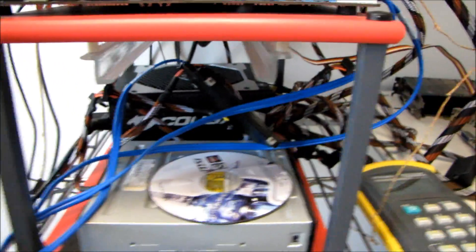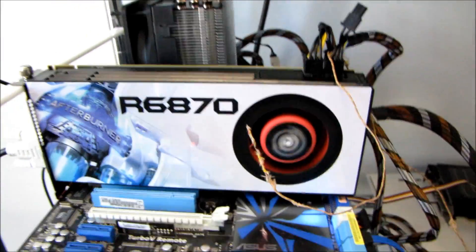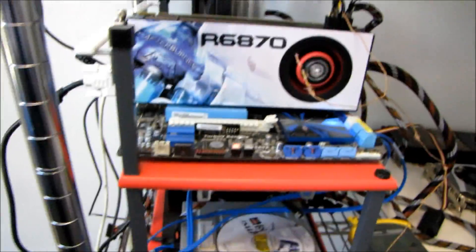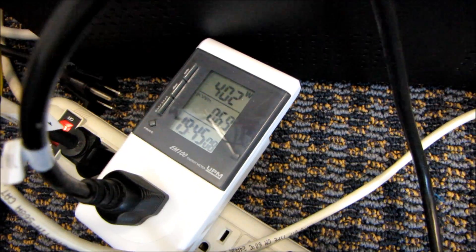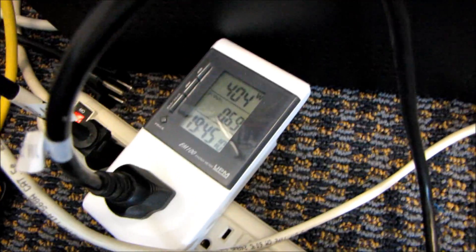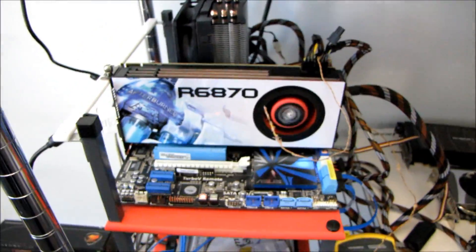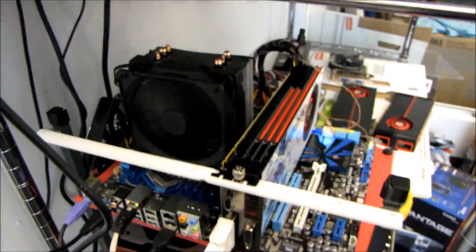For a system with an SSD, a couple of four gigs of RAM, a quad-core 875k processor overclocked, and a stock-speed 6870, you're looking at about 400 watts from the wall. You want to buffer that — make sure you've got at least a 500 to 600 watt power supply and scale from there. I'll also give you comparison numbers against the 5870 and the GTX 480 for context.